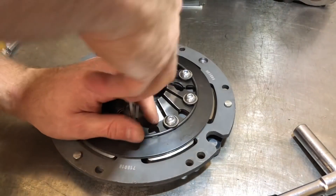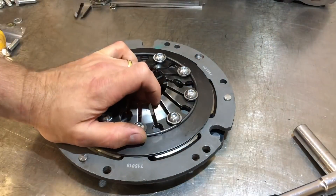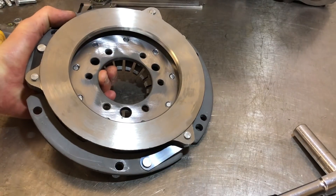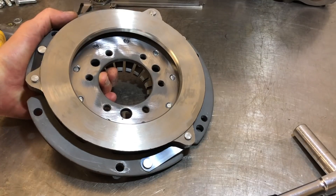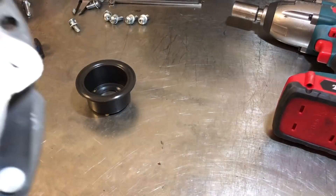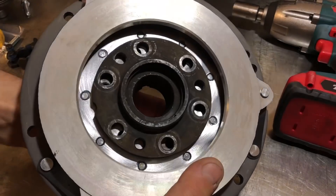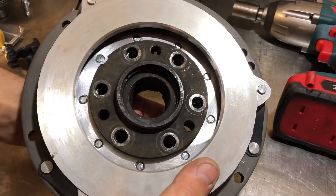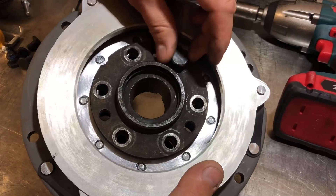The good thing about this clutch system is that it's really cheap to get some really good results. We used to use these on the turbo cars back in the V-Max racing days, going back to the early 90s. You can use two second-hand clutches and make a clutch that's really good for holding a lot of torque for peanuts — the bolts and washers cost about three pounds. Next, we're going to add the center for the crank. These bolt holes are all slightly offset so it will only line up in one position, and that should also allow the three puller bolt holes access.